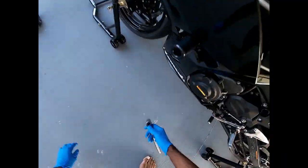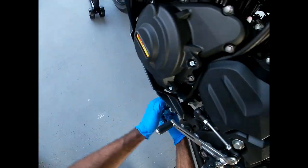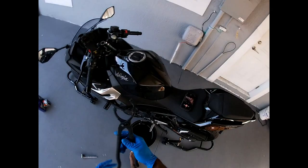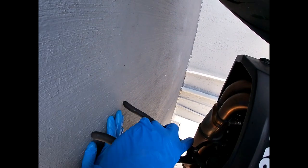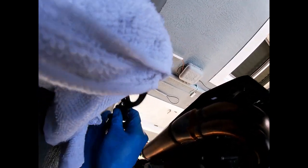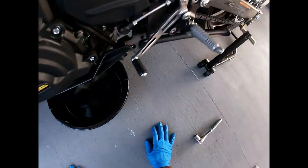What I usually like to do first is just loosen the drain plug to make sure I can get it — yep, it's pretty loose. Then the next thing is to make sure I can take off the oil filter. Turns out I cannot, so let me go grab my special tool. This tool grabs onto the filter and allows you to turn it. I'm crushing the filter but it's not coming off, so let me stop the tape.